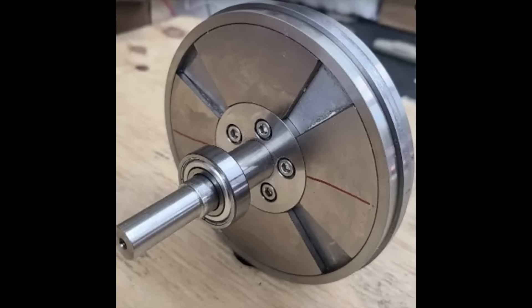They'd be correct, actually, in saying it's a pancake motor — the world of axial flux gets called that a lot. If you pull one of these out of the vehicle, you'd see it looks basically like a pancake. But the real difference between what we're creating and the traditional style of pancake motor is that usually within an axial motor, you have a lot of permanent magnets — that relates to a lot of rare earth metal, a lot of supply chain problems. What we've really done is found a way to maximize the actual conductor volume of the motor, to get more field coming from the stator as opposed to the reliance on the magnets. We can achieve great performance in a much more supply-chain-friendly way, save costs, and still get the great efficiency, torque, and size advantage that comes from pancake motors.